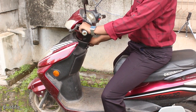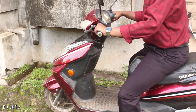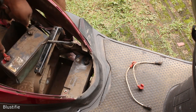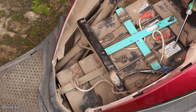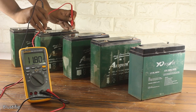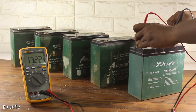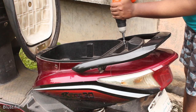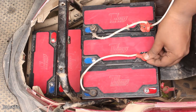Let's face it, my 3-year-old e-bike is about to die because its battery is going to die — it can't hold charge anymore. Needless to say, it's time for a replacement. This bike runs at 60V, which means we are dealing with 5 12V batteries in series, so we have to replace all 5 of them. Maybe one of these batteries is still doing well, but changing the complete set is always a good decision. So without further ado, let's disassemble the bike and replace all of them to put fresh new life into my ride.